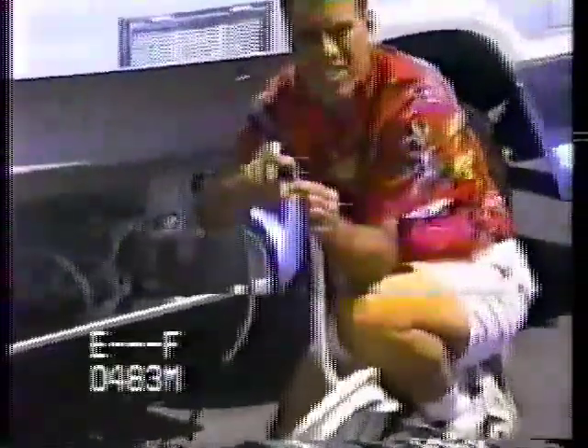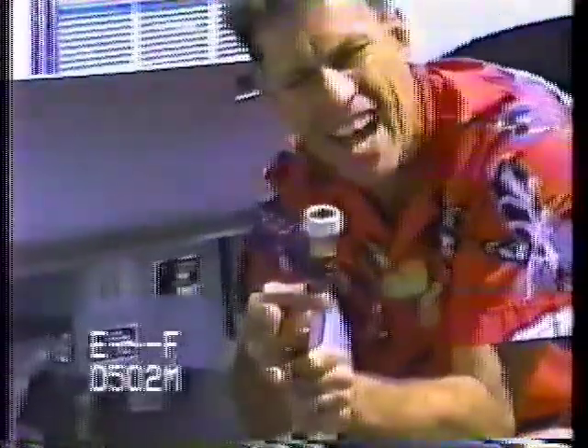It's very important that you get one of these brass water pressure regulators so that the water pressure when you're hooked into city water doesn't blow the seal out in the toilet. If you don't have this, you can blow the seals out in the toilet or even explode your fresh water lines inside. Hook it onto the front of the hose that attaches to the faucet. Put a piece of electrical tape around it so it always stays on there and it'll never come off.